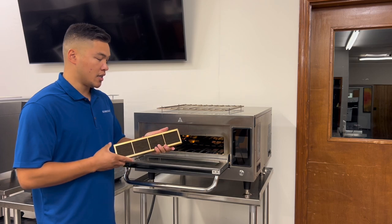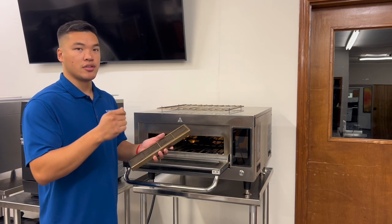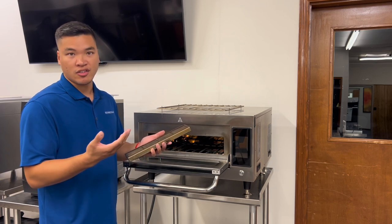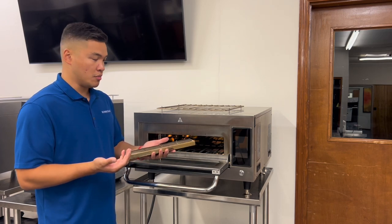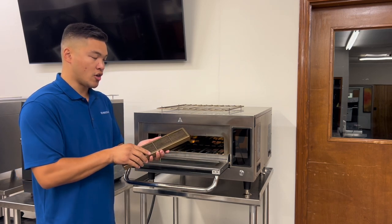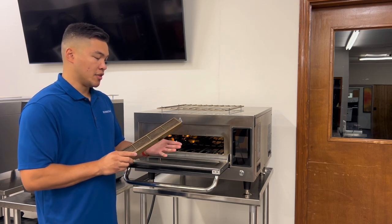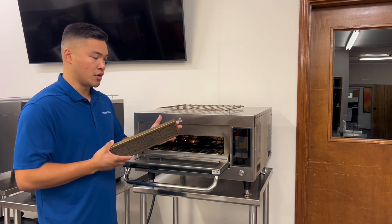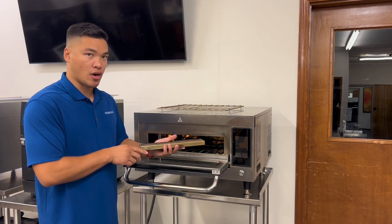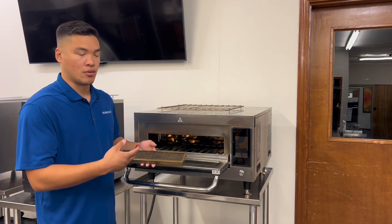Just keep an eye on it. The way to clean this is just to spray it down with your pre-rinse. Use simple soap detergent like Dawn dish soap, for example. Let it soak for maybe 10 to 20 minutes and then spray it out. I wouldn't try to open this up or scrub it with any brush — it's fairly delicate. Just hand wash, use your pre-rinse, let it dry, and then put it back in for service.